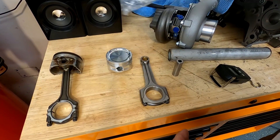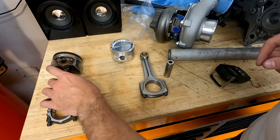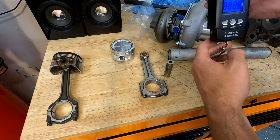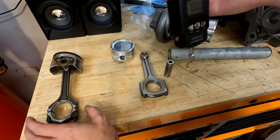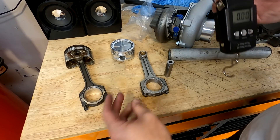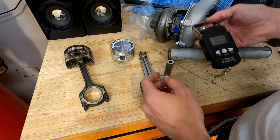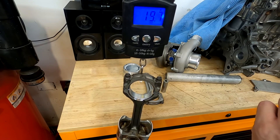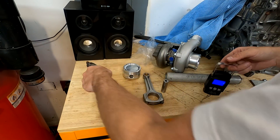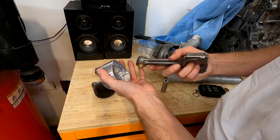Because of the nature of this build I've been obsessed with weight, and the engine weight is no exception. But at a certain point you just can't use light parts — you have to go to heavy-duty parts, and that is going to add weight every single time. The piston with wrist pin comes in at about 19.7 to 19.8 ounces.